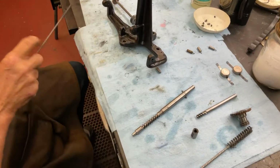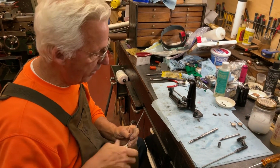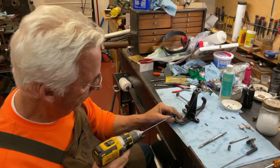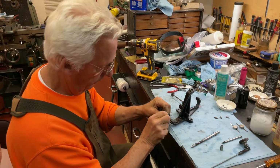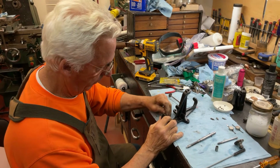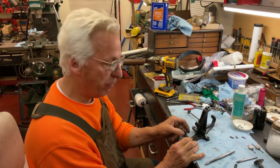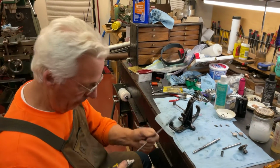So what I'll do is take my drill and put a flex hone in on this one. And it's still burred up. There we go. But I have a burr. There, it broke loose. Now this adjusts smoothly to put the governor in. Then I'll flex hone the spindle shaft hole.